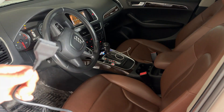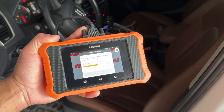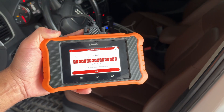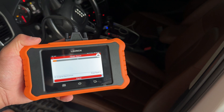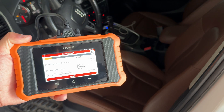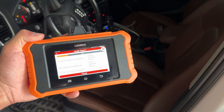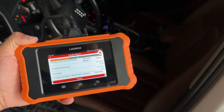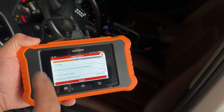I'm going to plug this into the vehicle and we're going to do a scan. As soon as I plugged it in, it picked up the VIN number and it's now doing a firmware update. You'll see it's scanning for the VIN number and picks it up right away. Interestingly, it didn't give me an option as to what to do — it jumped right into diagnostics and is doing a health report, going through each module to tell us if we have any fault codes. And as you can see, we do have fault codes already coming up.